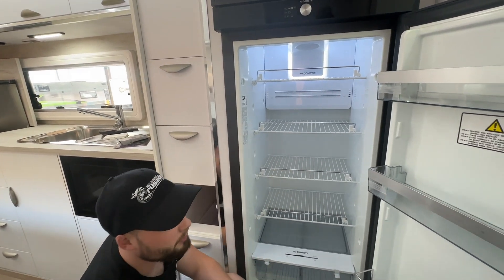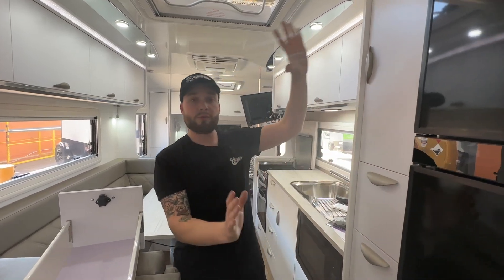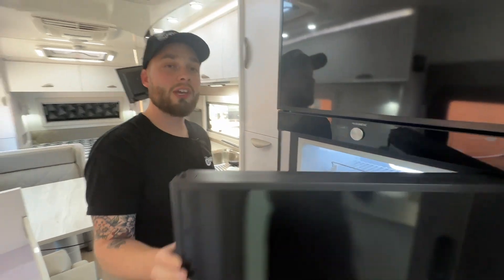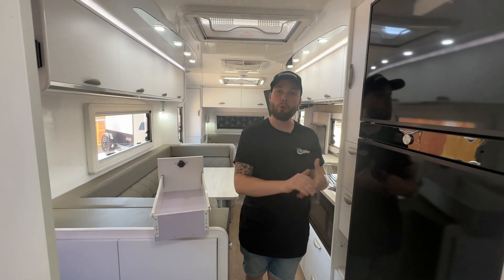When to contact Crusader Caravans and your dealer for warranty: when something is out of your control — for instance, an error 3 condenser failure, or if the fridge smells like ammonia. Take a photo of the fridge and the model placard so when they contact a Dometic service agent they can provide all the model information needed. For more information contact us at michael@crusadermelbourne.com, give us a call, or jump onto the next video for some fault-finding experience. Have a great day.